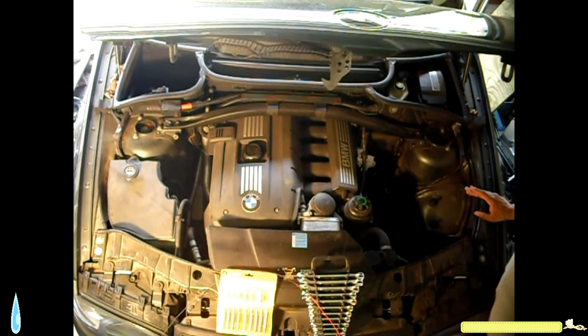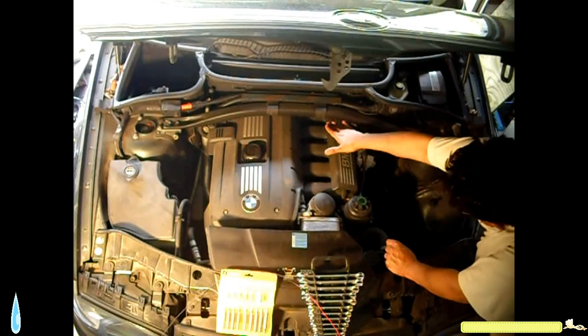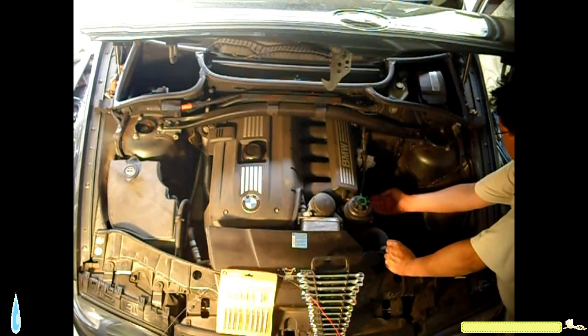On the stuff that I reviewed, the coil has a cable that goes through here. It goes to the starter coil. It's a white cable that goes through here, and it comes out through here, underneath the air muffler. There's a connection there. This clip is on the back. All you have to do is push on this metal clip. You push it in, and it unlocks it. That's the white wire that goes to the starter solenoid. It's a 3-prong, but it only has one connection. You'll be able to see it once you look in there. You can test it there. So I'm going to test the voltage drop there.